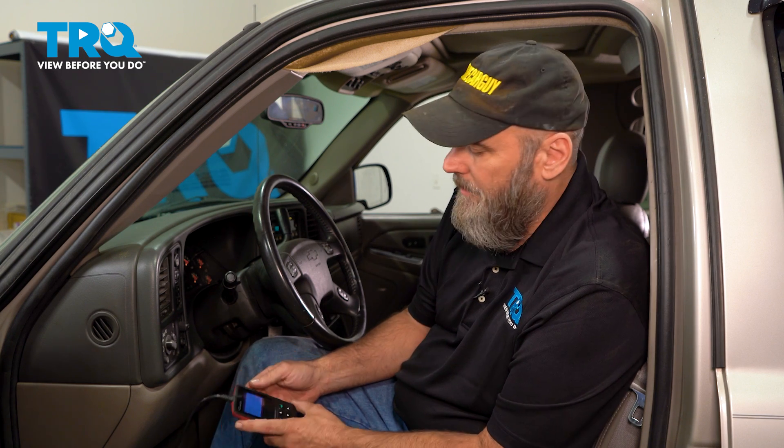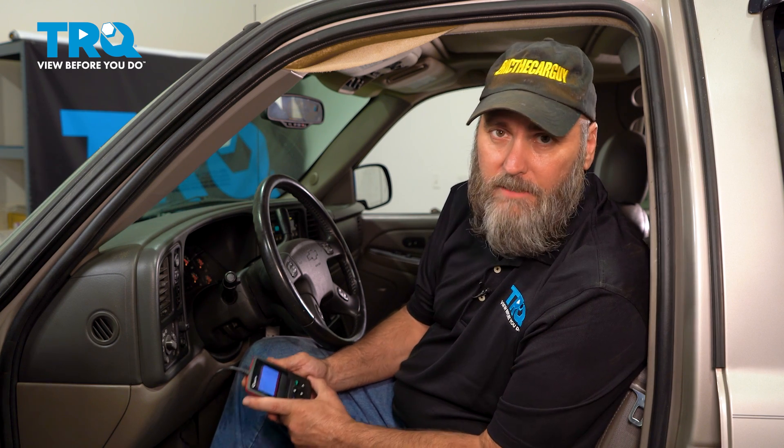In this case we have an engine coolant temperature of 179 degrees and an intake air temperature of 109 degrees. That 179 degrees of coolant temperature is definitely below the thermostat rating, which I believe is 195 — but even if it's 180, we're still below that. So let's start the engine and see if that temperature will rise above that, and if it doesn't, we might take a closer look at the thermostat.